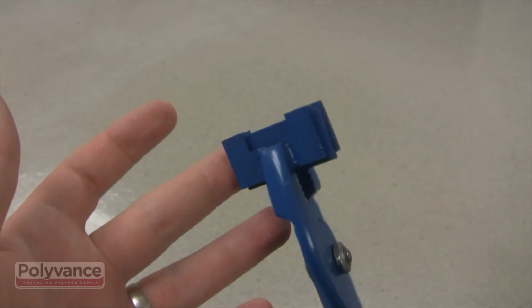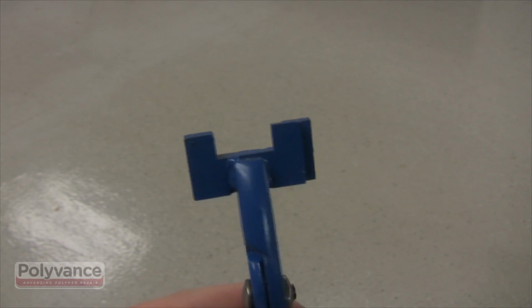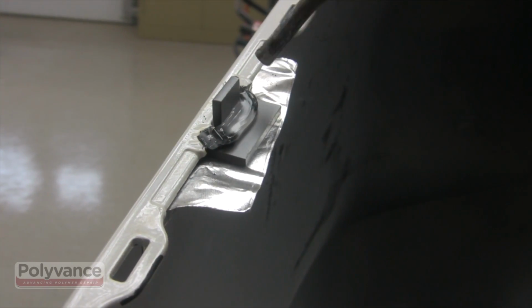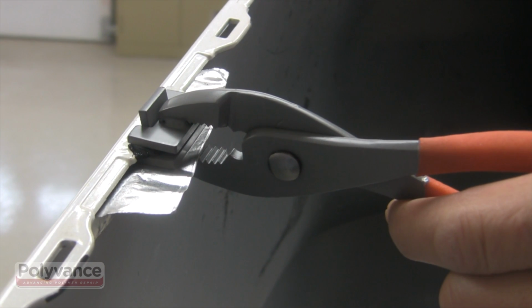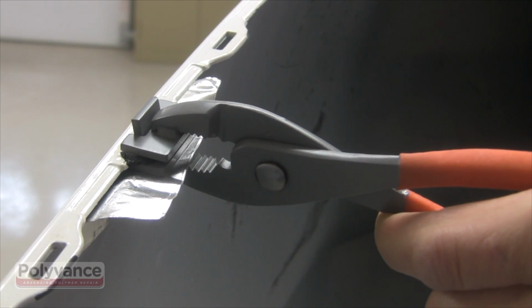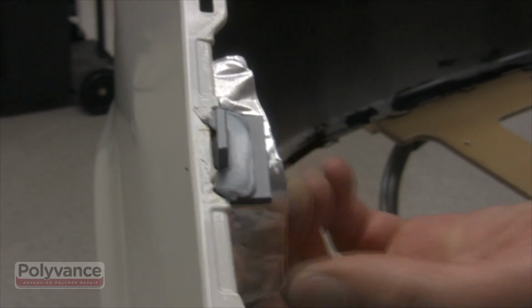Each set of pliers has 2 flat areas, each of which matches the width of one of the color-coded dies. Make sure you have the correct pliers and the correct side of the pliers. Reheat the tab so that the welding rod becomes nearly translucent. Use the proper side of the matching pliers to gently press the weld flat. Hold the pliers in place for a few seconds while the plastic cools and solidifies. Remove the pliers and let the weld cool completely before the next step.